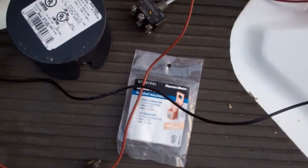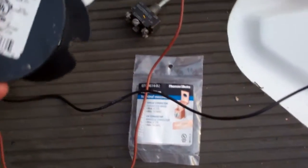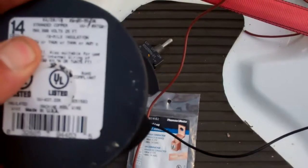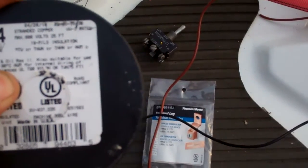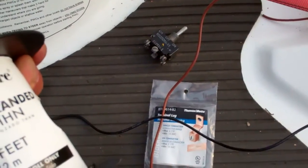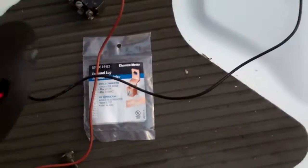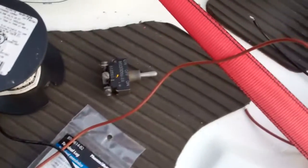When it comes to the wiring, I didn't go buy marine wire because if you go with stranded copper, number one; number two, make sure it says it's gas and oil resistant; and number three, make sure the temperature rating is high enough that it's safe to use. I'm not going to spend extra money for marine wiring when it's basically the exact same thing, just jacked up in price.